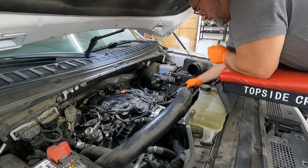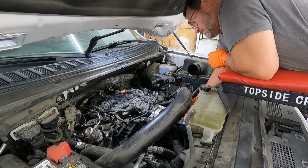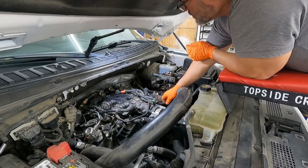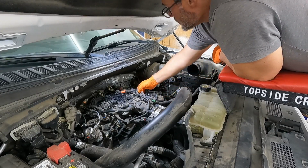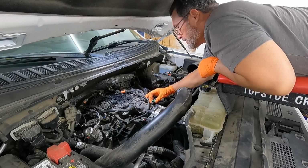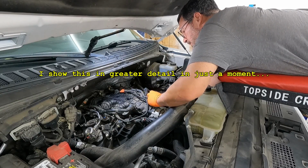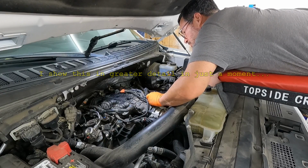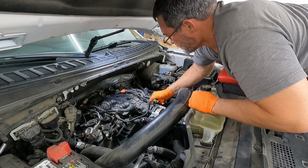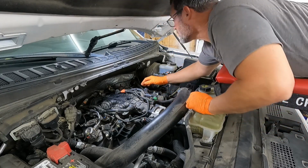And there's the red one. And then it's also attached to the inlet over here at the throttle body. So we'll go ahead and detach it. Wow. A million of these things. Evap hoses. This is part of the purge valve system here. So we can take those apart. It's got 4 clips, not just 2 little fingers, but 4 fingers that have to be released in order to slide that lock out of the way. Wow. What a mess. Okay.